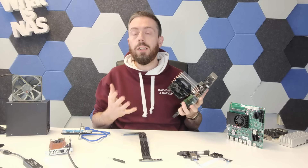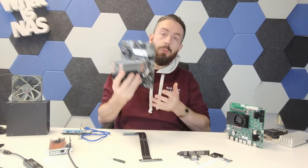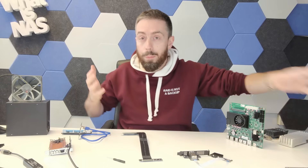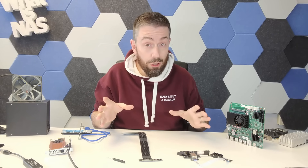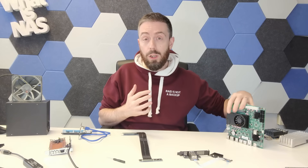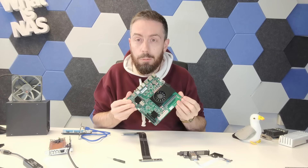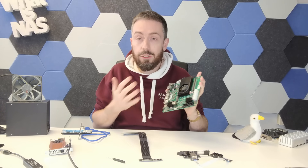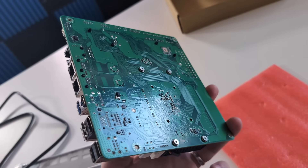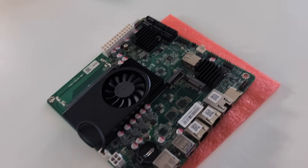Let's tackle what I think is the most interesting area of DIY NAS upgrades that have evolved over the last few years. We've seen MATX and ATX motherboards get less and less popular for network-attached storage deployment, especially for more compact builds. When you look at MITX motherboards like this one, you're losing out on PCIe upgrades. With PCIe slots getting fewer — such as this N100 board that uses the slot for 10G — M.2 becomes the de facto entry point for a lot of upgrades.